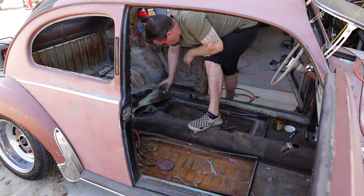The original floor pan, I ground down the edges, and then I don't know if you've seen, but I went over with the hammer and dolly. These lips here actually start to curl down where I cut it, if I cut it an inch back from where this is. So I hammered them flat so they pucker up, so that when I plug weld these, they won't be down away from the plug weld. They'll be nice and tight to the new floor pan that we're putting in. So anything that started to curve down all the way around, a hammer and dolly did.